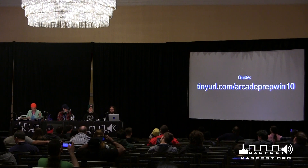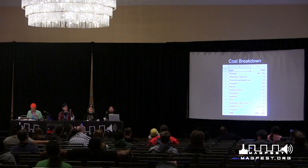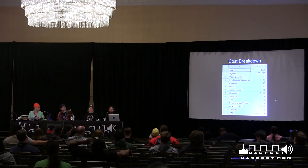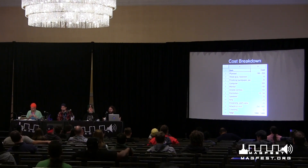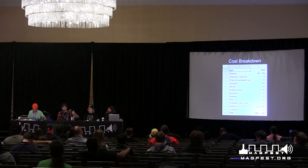Last, we're going to talk about setting up a computer as an installation. A lot of our arcades when you plug them in just boot automatically into software. Andy Wallace wrote a really nice blog on how to do this specifically for Windows 10 — there's also a guide for Mac and one for Windows 7. This tells you how to disable sleep, turn off updates, and all the stuff you need if you want to make an installation that boots into software without shutting off, having pop ups, or anything like that. For the cost breakdown: this cost us roughly $1,000 to $1,400. Vinyl can be up to $500. If you wanted to build your own arcade and have to buy all components, a good cost is about $1,000. If you have a computer and screen at home, or know someone with a wood shop with plywood lying around, you could probably get that cost down. In general you can trade money for time here.